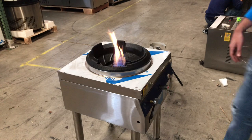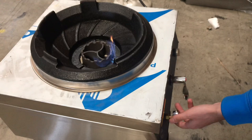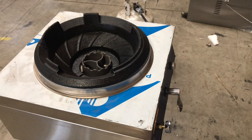Once you're done, you can just press it all the way down. You'll see that there's still going to be a little fire on there because the pilot's not turned off. So what you're going to do is rotate it all the way to the right until it's tight, and it'll turn off all the fire from the front.